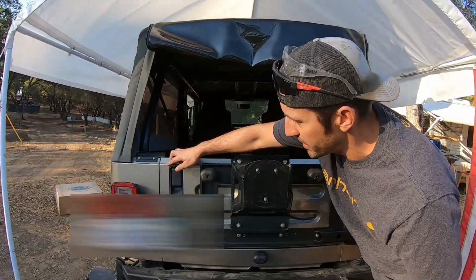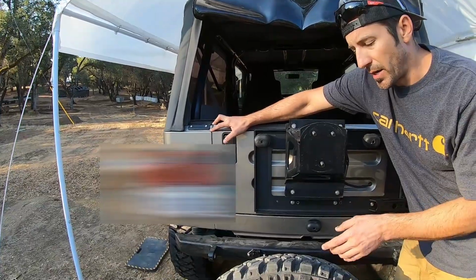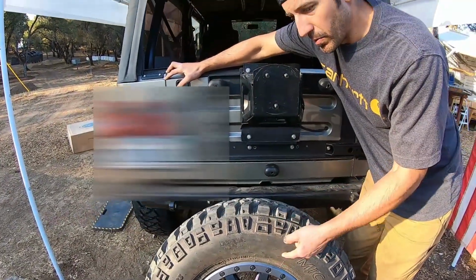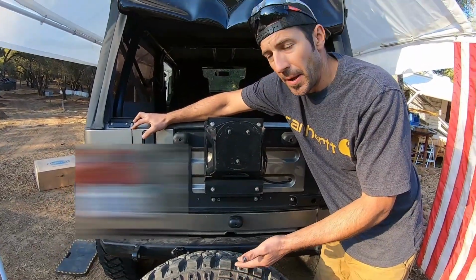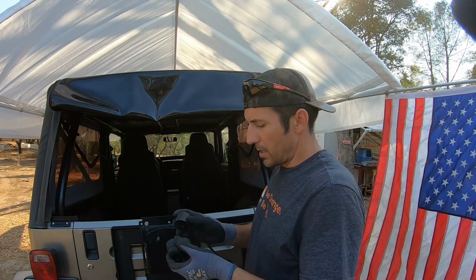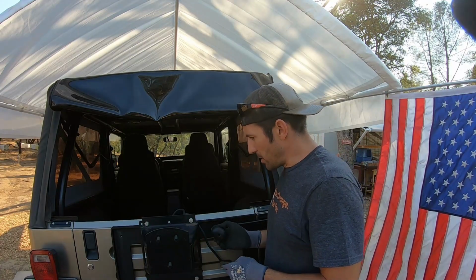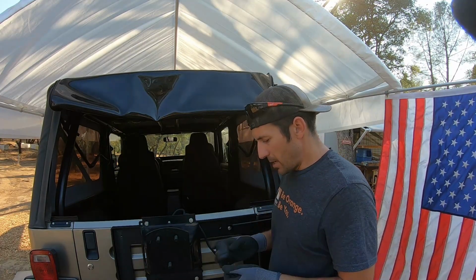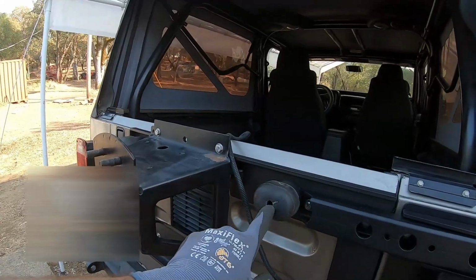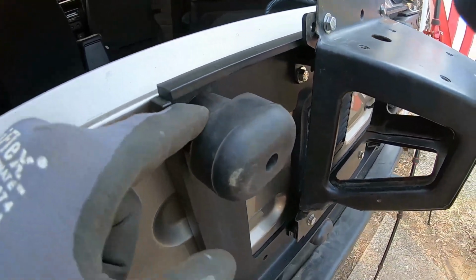You can see the body lines, and if anything, this is up like just a tad bit because again, we're trying to anticipate this 75. Well, the tire probably weighs about 70 pounds. The rim is probably 25. It's about 100 pounds. They give you spacers, only one set, and hopefully they work, or else you could cut these down, I guess. But we'll see. We'll put two there, one at the bottom. The odds of them touching perfectly the first time are slim to none. And now we pre-mounted the snubbers with the spacers they provided, which are about 1.5 inches thick.